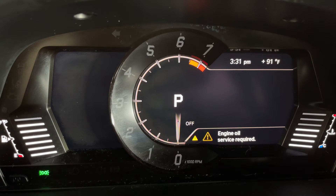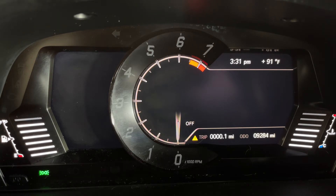So to start, you need to put this thing in pad mode. Pad mode is basically an ignition-on on a normal car that's got a key. Since this one has the start-stop button, you hit the start-stop button three times consecutively, quickly.